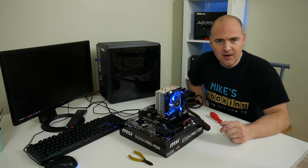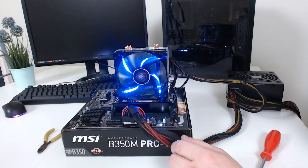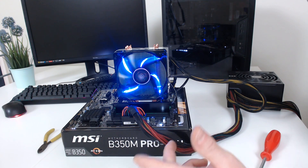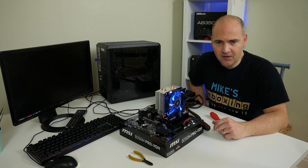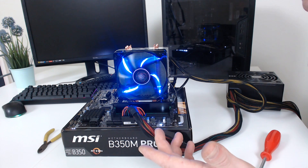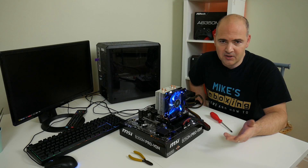So you've just got your new MSI motherboard, the B350M VDH, and you've got your Ryzen APU, and you turn it on, and the first thing you get is a single CPU LED on the EasyDebug LED system. What that means is you need to upgrade your BIOS. I'm going to show you how to get the BIOS files and how to upgrade them.